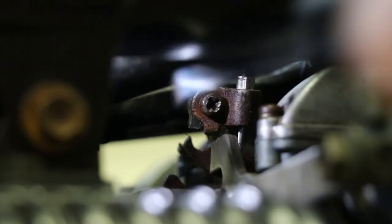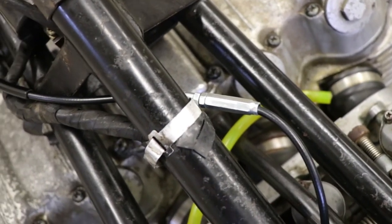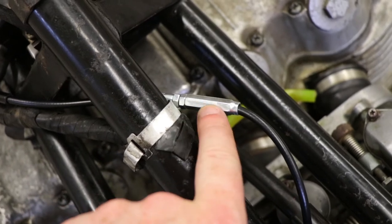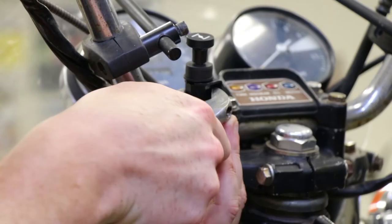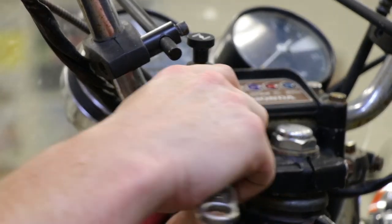This screw really should be changed. What you want to do is there's a metal sleeve section right here — kind of line that up in the center, then we'll use the adjuster further back on the cable to perfect this once we've got it all in place. This is a brand new cable, so I haven't had to adjust out anything here. It had a little bit of slack from the factory, so I tightened it up. Now when I pull the plunger, I have just the right amount of slack — just enough to activate and start working the linkage. When you pull on it, the linkage moves, then the choke opens. That's maxed out right there. Don't forget to tighten up the cable — you don't have to get this zinging tight. This is just plastic, don't break it.